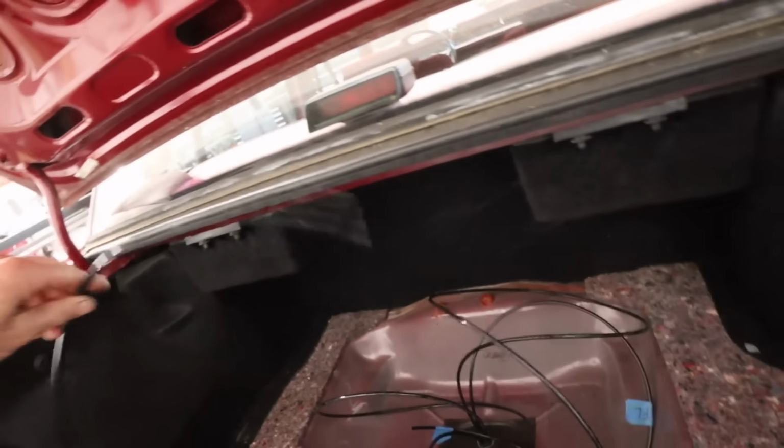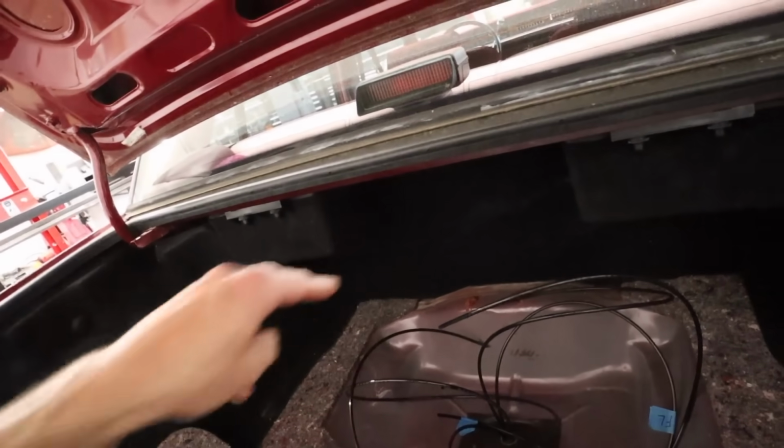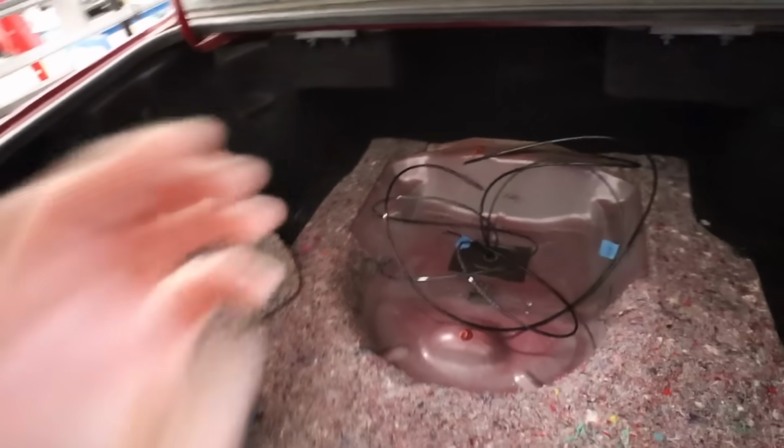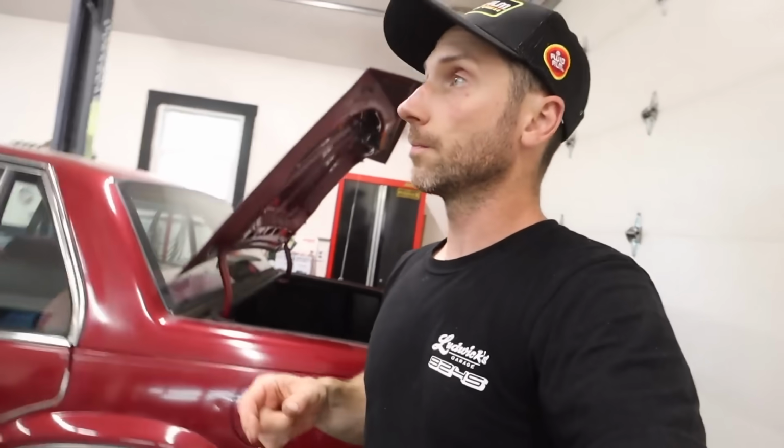So what I'm gonna do real quick so we can articulate the suspension is I'm going to tee the front off, tee the rear off with some push to connect fittings. And just like you saw in the last episode, run a Schrader valve off of those tees so we can use the air here in the shop to make the car go up and down. Because we have not pulled interior, we haven't wired the car, we haven't done our management yet. That'll be in the next episode.